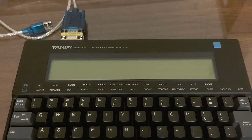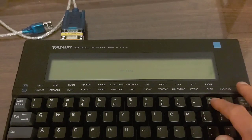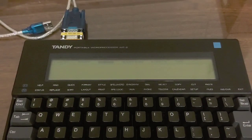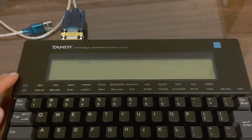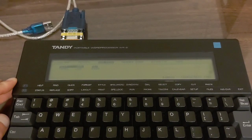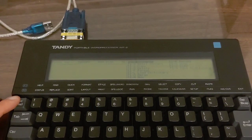There's also an excellent tool for file management, which we access via F2 and files. Okay, F2 files. First, I need to exit, and then F2 files. Okay, and this lets us see what's in the 5 possible storage locations. The internal memory, that 22K I mentioned, RAM disk, which for me is 128K, as we can see, 120-something-thousand characters free. The memory card, which we don't have and probably can't, and so on. Using this tool, as we'll see in the help utility, you can delete files, manage them, copy files between different storage locations.